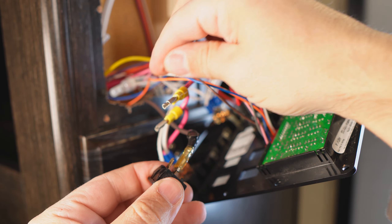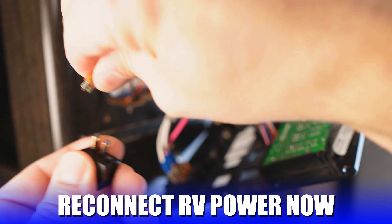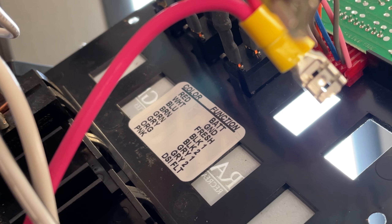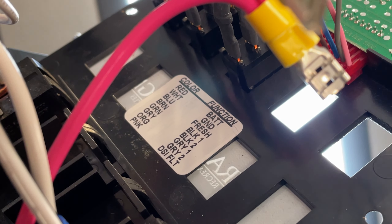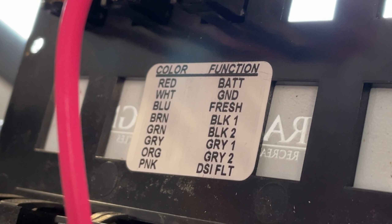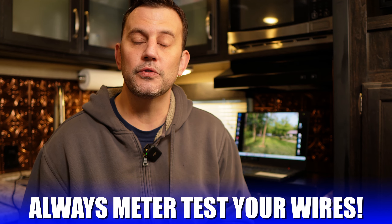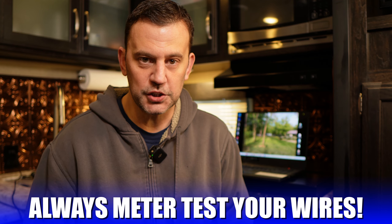Next, let's remove the switch from the wiring, and you will need to reconnect the RV to power at this time. You may have a wire color cheat sheet on the back of your panel. On mine it says the white wires are ground and the red wires are battery, which means 12-volt positive. They definitely help with finding wires, but I'll always recommend using a meter to test and confirm your wires before making any connections.